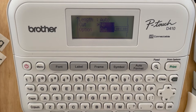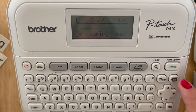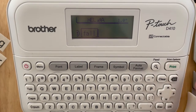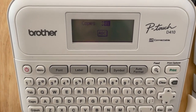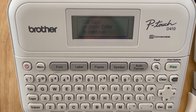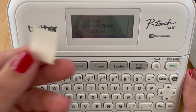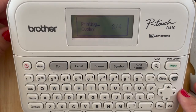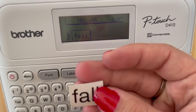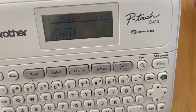Now for Chain Print — go to Label and select Chain. Chain Print is if you want multiple copies. Let's say you want four copies of the word 'fall.' Hit OK and it starts printing. It will say 'cut tape or press Enter to continue.' You can cut that leading margin of tape or keep it. Chain Print cuts everything with small margins and cuts between labels for you automatically. We've now covered small margins, large margins, no cut, and chain print.